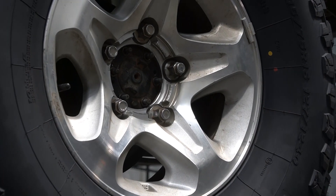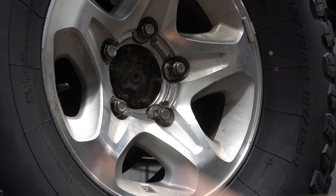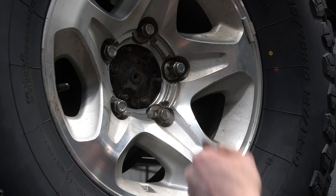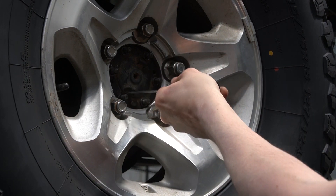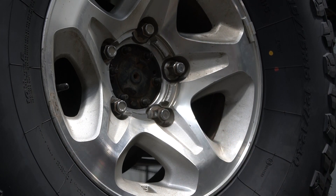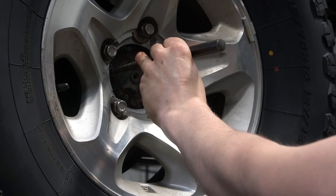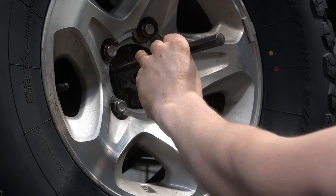What you might see online is people clobbering these studs with a hammer, and that's a pretty silly idea for obvious reasons. If you can move them with a screwdriver to pop them off, that's the ideal way to do it. But if you do have to shock them off, use a punch on the studs — that won't round the head unless you absolutely wail on it. If you're having to hit harder than you'd expect, you're doing something wrong.